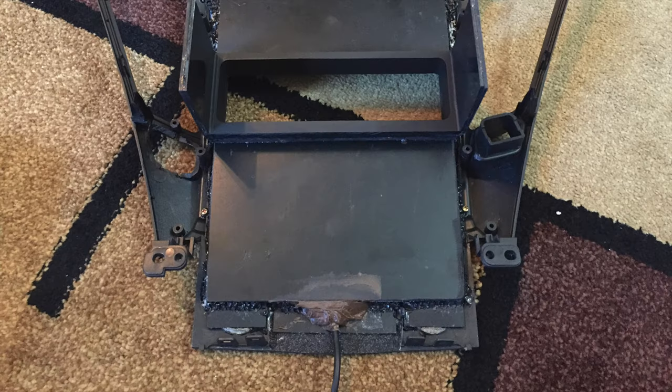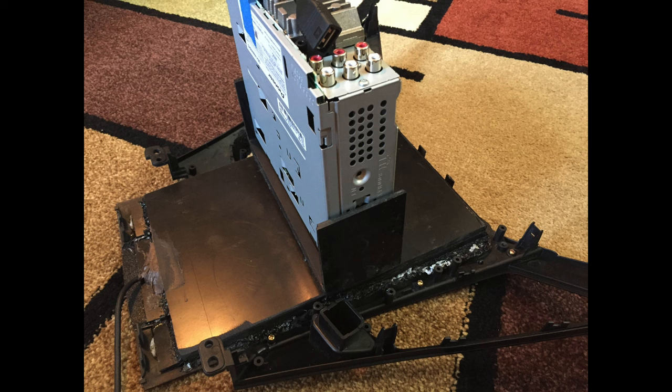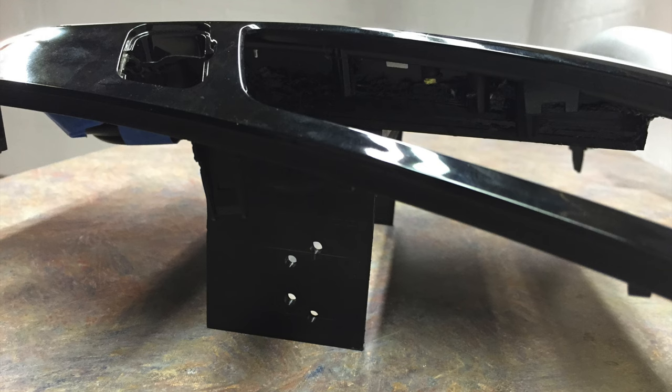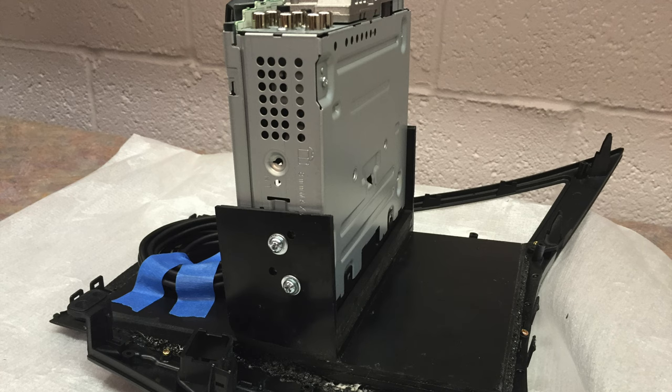Here's the back of the kit. You can see where the lightning cable is glassed in at the bottom, and also the cutout where the single-din is going to be. I did some test fitting and found everything lined up perfectly. Here you can see how it's recessed just enough so that the volume knob doesn't stick out and rub up against the iPad. The first step is to measure where the screw holes are on your single-din, line that up with the side rails on this kit, and drill the holes. This is the longer screw and the two types of washers I use to make sure it screws in all the way and has a nice secure fit.